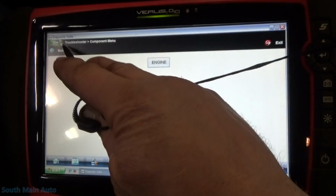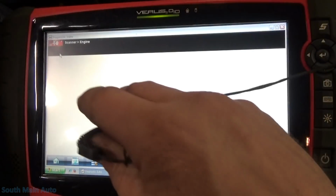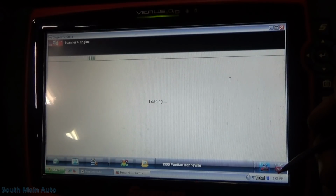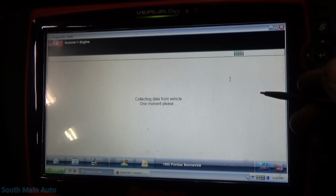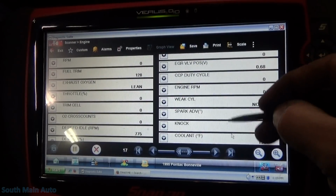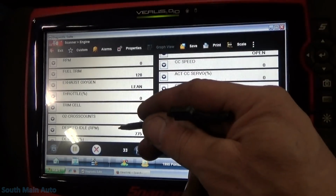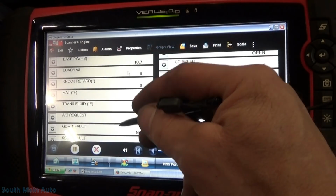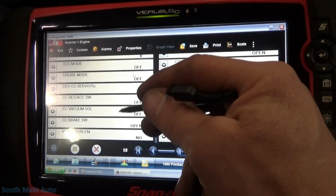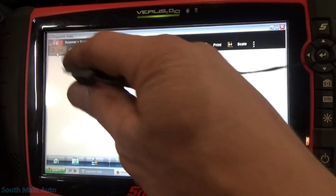I doubt it. Might be worth just a glance. Ugh, dang, I keep getting click happy here. Data display, because these older ones, this was like OBD1 data. I think it's just going to be engine business. Not worth a look while we're right here anyway. Yeah, cruise control, PROM ID. The old quad driver model. Man, I haven't seen this old stuff in forever. Cruise, VATS, vehicle anti-theft, so nothing there is going to be of any use to us.